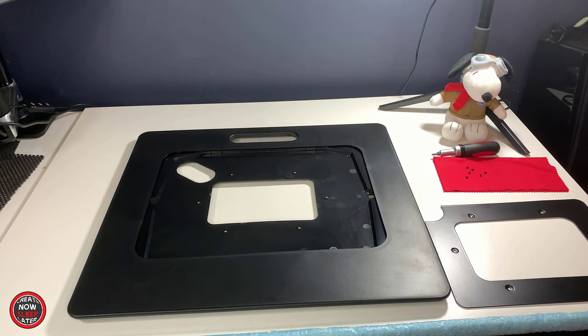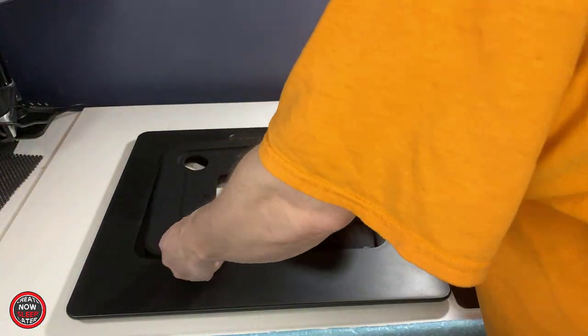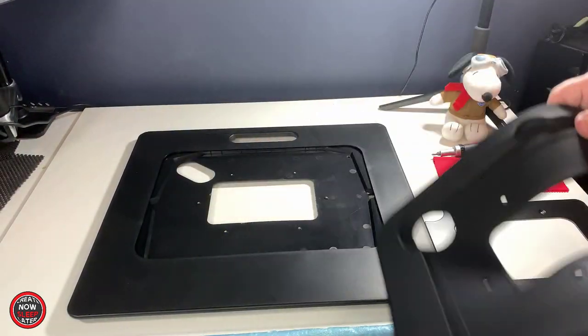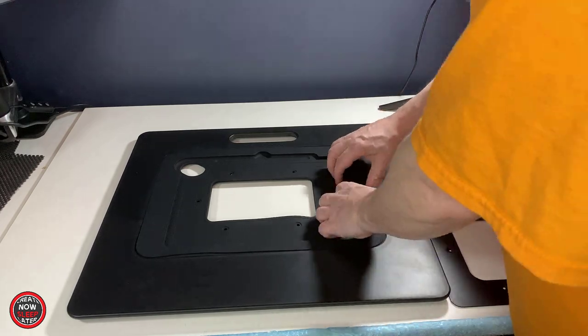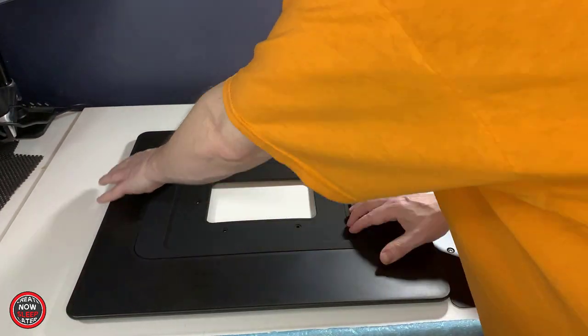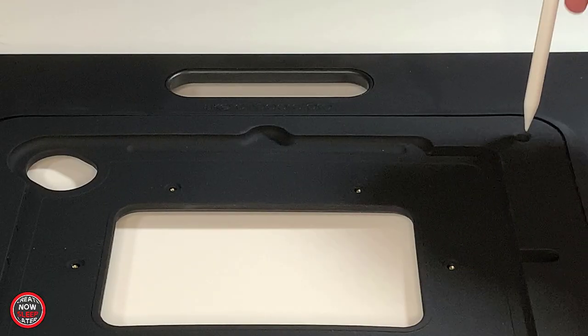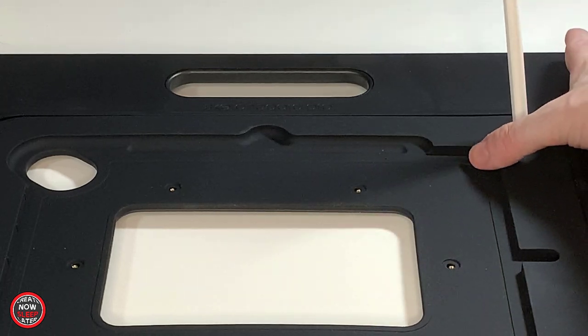I think one of the reasons you're experiencing the iPad falling out when holding it by the handle is because you're not really getting a clean connection to that magnet — everything's so tight that it's holding it in there, but it's not flush against that magnet, and that's why it tends to pop out. The solution is easier than you think and probably only takes 10-15 minutes. So this is the actual rubber insert — you can see the six screw holes. What's meant to happen is you put the screw through the rubber insert, through the metal magnet, and that keeps everything in place. Now put your Apple Pencil in there where it belongs, because it's going to serve as a guide as we adjust this.